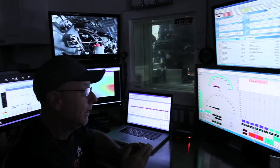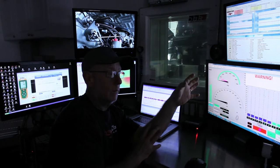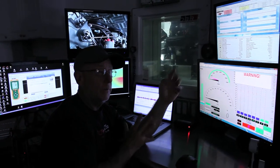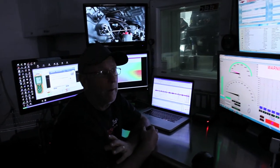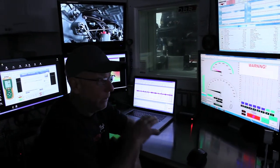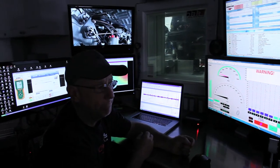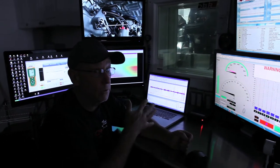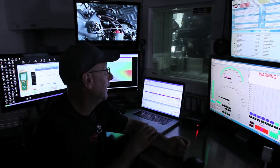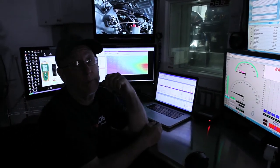Really excited. The heat soaking issue that's very common to these XSs, we've been battling that for a year. We have more of a handle on it now than we ever have. And just a sensor change, a map change, a $1,000 kit, you'll pick up a bunch of performance. I think our tube kit, again, a tuner and a throttle body, that's in the works. We're getting great results there. We'll be doing another video and letting you guys know about that pretty soon.